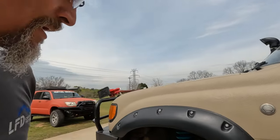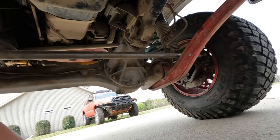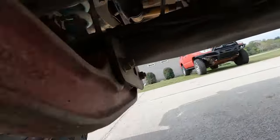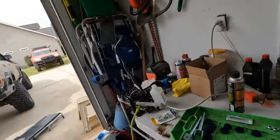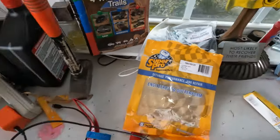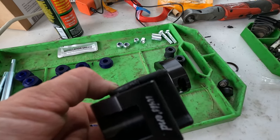I don't run one on the front — I actually ripped that one off on a trail and the sway bar bracket sheared off. I think it used to be right there like this one is. Never put it back on. I feel it's stable enough without the front one, but the rear one I absolutely want on. So I figured I'd walk y'all through it. I'm putting in the Super Pro kit, and these rear brackets are from Wits End — a great resource for 80 series parts.